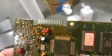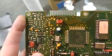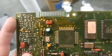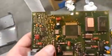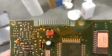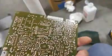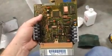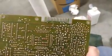Once you're done scuffing both sides and you've got nice bright terminals, hit it again with more rubbing alcohol to wipe off any traces of Scotch-Brite dust, and you're done. Then you can put the emulator or chip in it, but I don't install the chip until after I've reassembled the PCM. Reassembly is as simple as putting all the screws back where you found them. Don't over-tighten the PC board screws — you don't want to crack the board. On the outside screws you can put a little more tension, but on the board screws take it easy. That's it: lightly scuff with Scotch-Brite, wipe down with alcohol when done, make sure all conformal or grease coating is gone first, reassemble the computer, and it's ready to go back in the car with a chip plugged in. The hardest part is actually getting the computer out of the car — doing the work is a piece of cake. Maybe I'll bring you guys along later when I plug the chip in. For now, see ya.